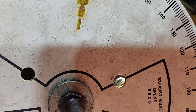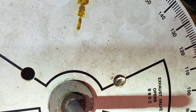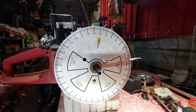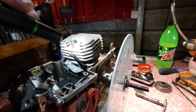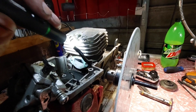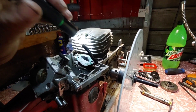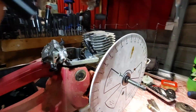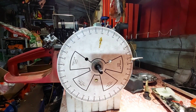The transfers should be 125 degrees - I've worked that out too. Yeah, I'll get that worked out. I'll pull the cylinder back off, put a ring inside the cylinder, then get it back out, pull the ring off and put it in the cylinder, and I'll wind the motor over until the piston hits the ring and work out exactly where the transfers open up. I'll work it that way for the exact numbers.